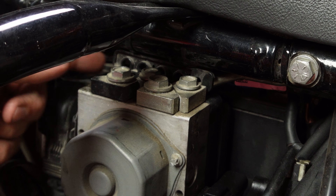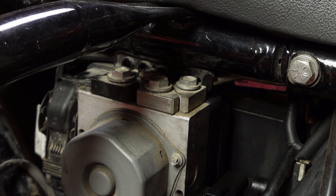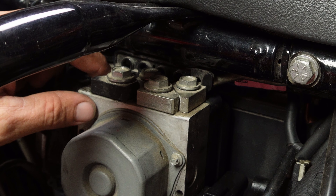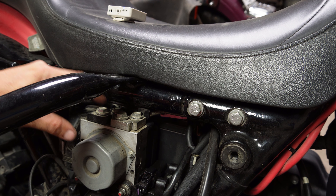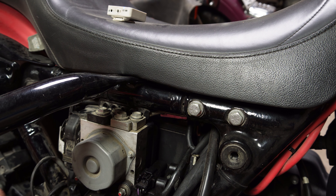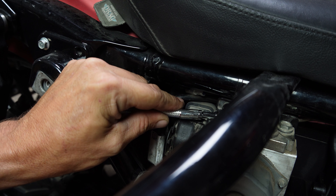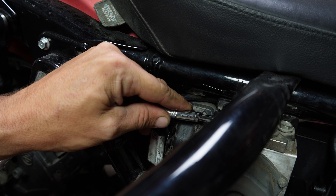To get that line out of here, there is a plastic clip that holds all the lines in place and keeps them where they should be. Now, because we're using a standard banjo fitting, we're not going to be able to keep that in place, because the standard fitting is going to come off here, run this way down, loop around, and then come back up to the brake caliper. So we're going to get this put on here on top like this. These should fit with your existing lines if you're just replacing one.